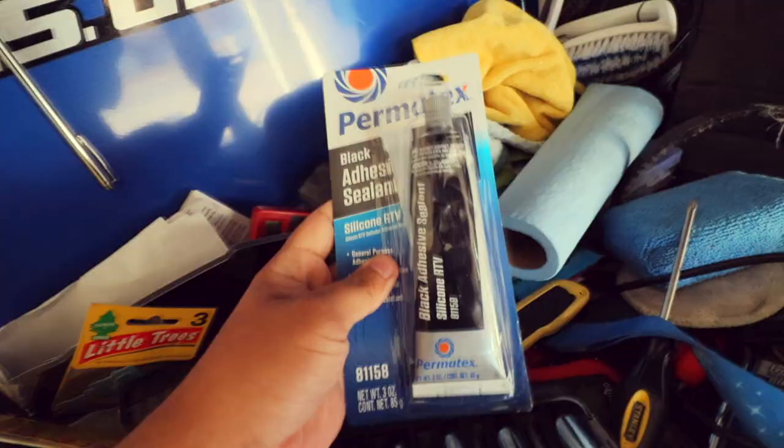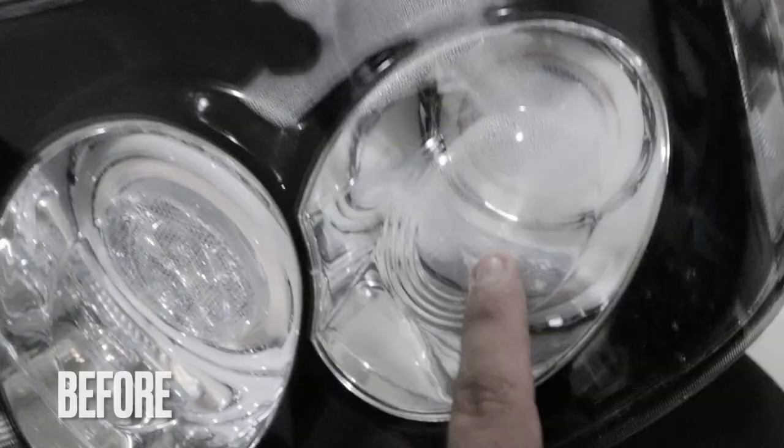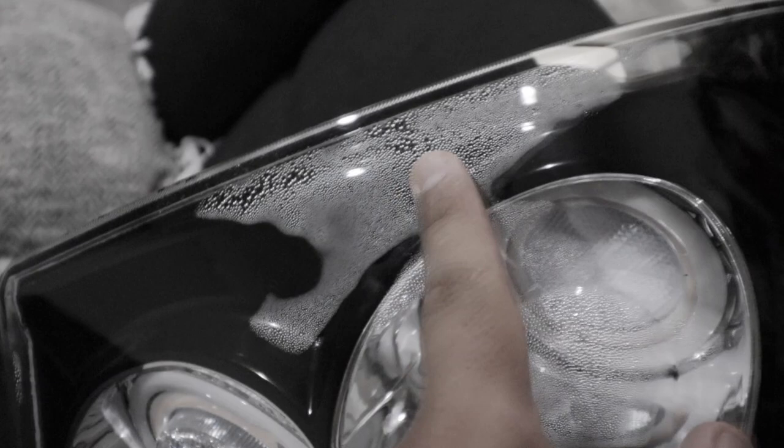Before we go in, this is the silicone we're going to use — it's just black silicone. Here is what my taillight looked like before: you can see condensation here, condensation there, there was a lot more — some of it's dried up now. This is what my taillight looks like now — all dried up. Last time I installed the silicone, I just applied it right out of the tube, but you really gotta push it and spread it around so it fills up all the holes and cracks you may not see with the naked eye.